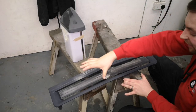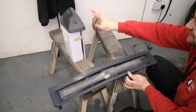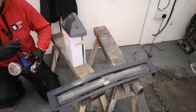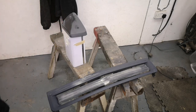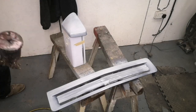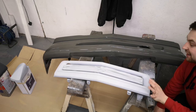So the next thing: I have prepped the grill. There are a couple of little bits I'm not happy with, so I'm going to high-build the grill, which I didn't really want to do, but needs must. I'm also going to high-build this wing mirror cover because it's gone back to bare plastic in places and I just want to make sure it's got a really good finish. Always use a proper mask — it's a lot safer, better for your lungs in the long term. Two coats are now done. It's been 24 hours, the primer's now dry, so I'm going to block it back and then we're going to put the grey paint on.